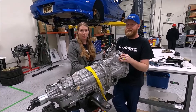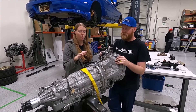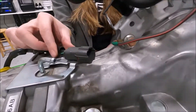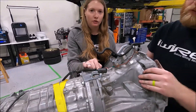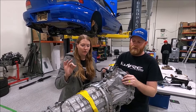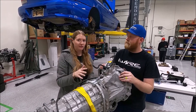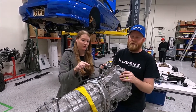While we have the transmission out, we thought we'd do a little breakdown of the wiring. One of the key things is this plug that comes off the transmission — this is a six-pin plug, which means it's DCCD equipped. As a rule of thumb, most six-speeds are DCCD equipped, but the way to truly tell is if it has the six-pin connector. There are some five-speeds that are DCCD equipped and some six-speeds that are non-DCCD equipped.